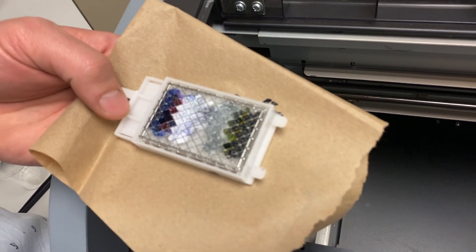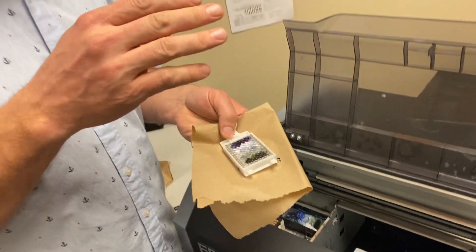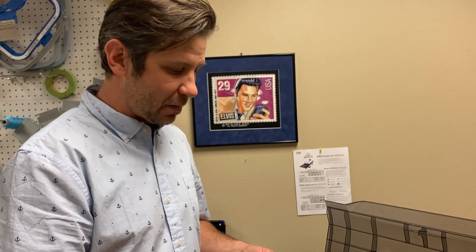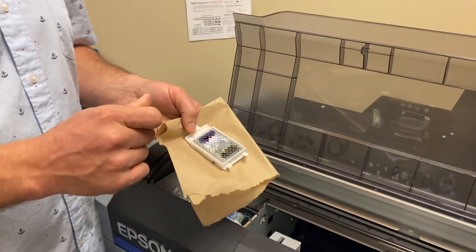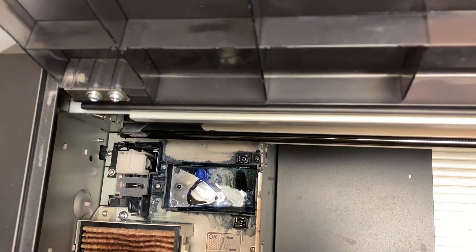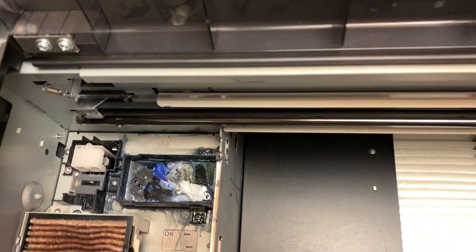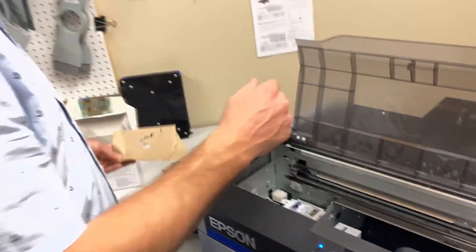Notice how dirty the spit tray filter is down in here. This is really important to keep clean because when the printhead spits ink on top of it, if it's not draining, those ink droplets are just dispersing and spreading throughout the printer. We do have fans and filters to mitigate that, but we want to keep this as clean as possible. When this gets dirty and saturated, that's when it's time to clean your printhead — think of your head cap and the spit tray filter as two important things to do together. Any leftover solution can be poured down here to help keep those lines clean. Once rinsed, you can pop it back in wet — it doesn't matter.